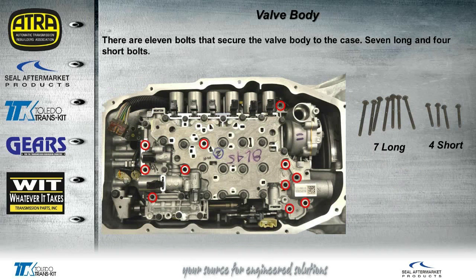To remove the valve body, you're going to find that there are 11 bolts — some of them are long and four are short. I didn't really bother to mark which ones the short ones would go to — if you're actually working on this valve body, you'll easily see where the four shorter bolts will go. I just wanted to mark out which bolts you have to take out altogether.